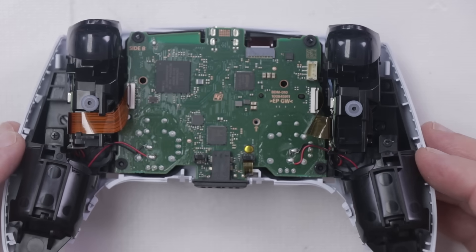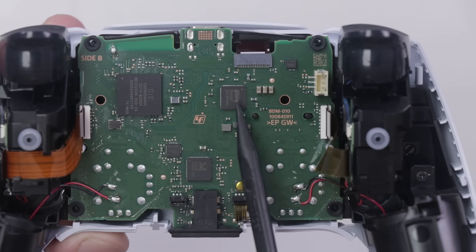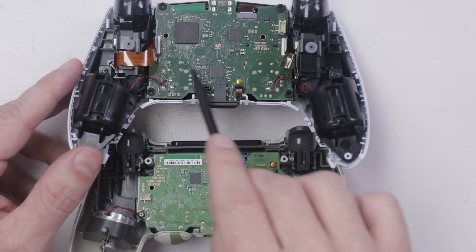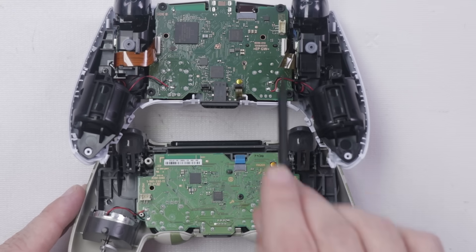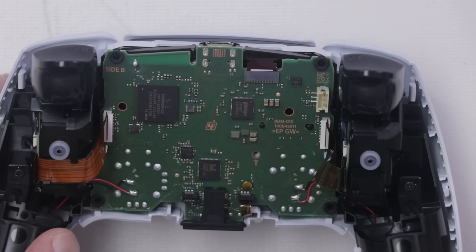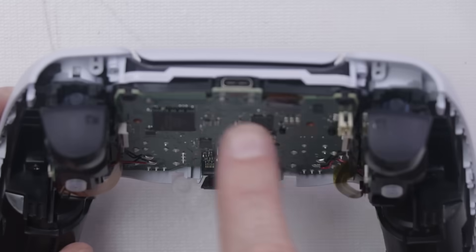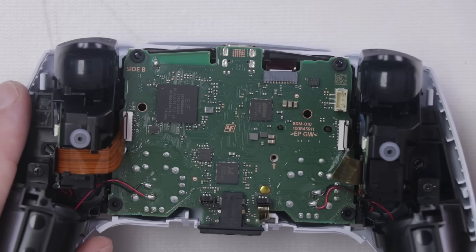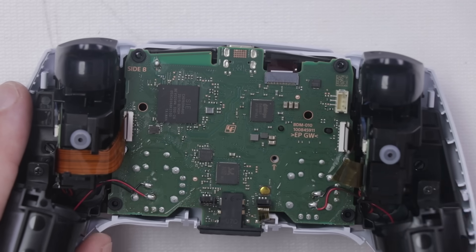And the first look at the motherboard — there's definitely some pretty good sized chips. We've got a large BGA chip and then several other chips. The DualSense motherboard is much larger and has some much larger chips on it than the DualShock 4, which is definitely to be expected with the more advanced controls. One of the things we want to pay attention to as far as repairability is this USB-C connector right here. Traditionally, cable connectors are some of the things that are often abused in controllers and many other electronic devices. So once we get this motherboard out, we can take a look at how it is mounted and how strong it is.